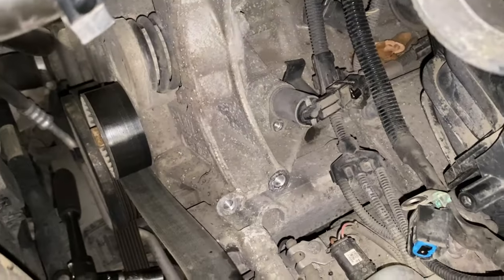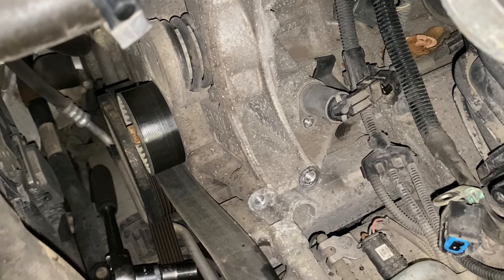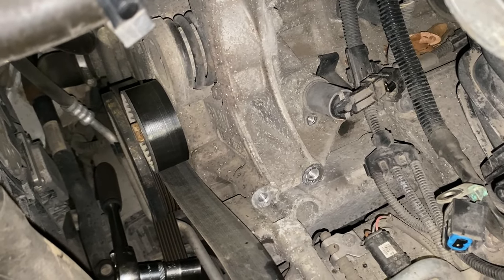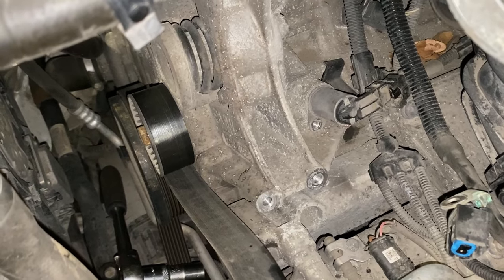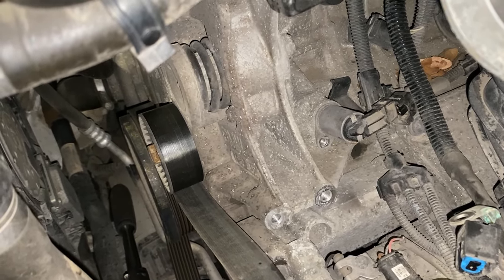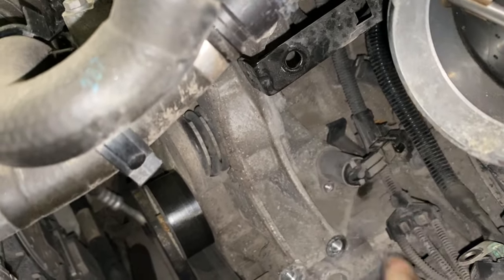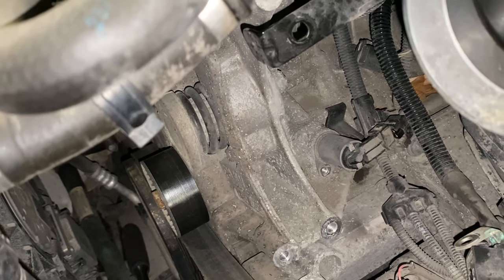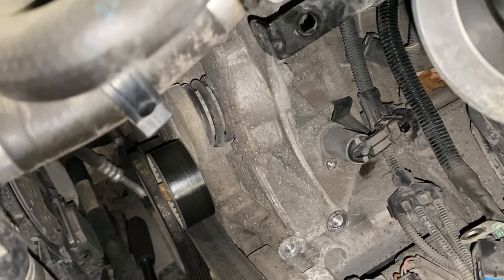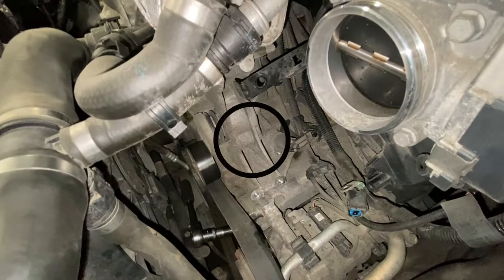This engine is map control. So the oil pump is a slide pendulum pump, and it really just ticks over. And this thing is what controls your oil pressure. If this thing's not working, you've got no oil pressure. It's as simple as that. And there's a relief system on there, it goes into a limp mode, and I think it'll run about one bar. So let's whip that out and see if we can crack on.